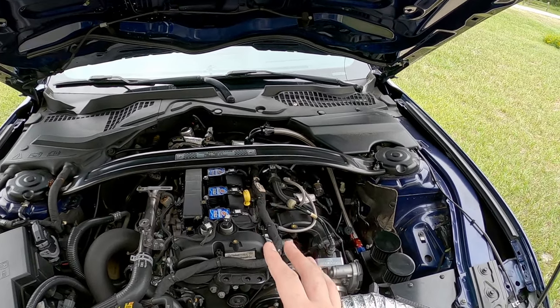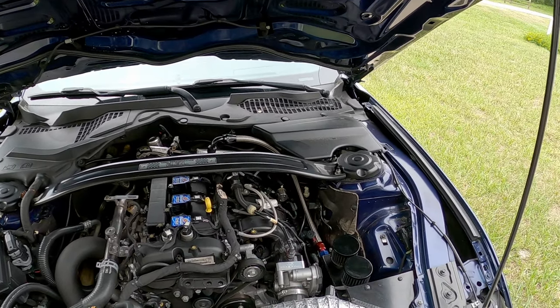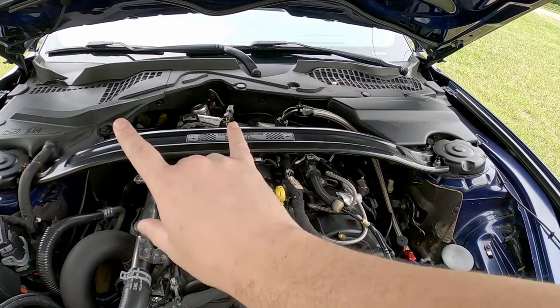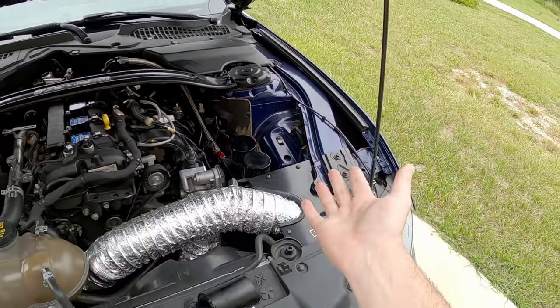It's definitely not a good thing to have all that oil make its way into the induction system. Thanks, Ford. Anyway, I decided to delete both catch cans and run it straight to this tank, and it's been working pretty good. Except there's an unfortunate side effect that has now created a whole other issue with the livability of the vehicle — it drives fine, but having to live with this side effect is a bit annoying.